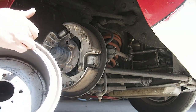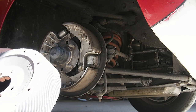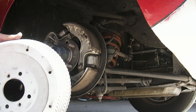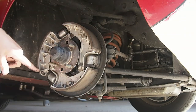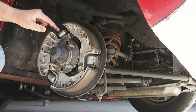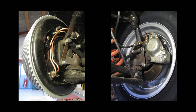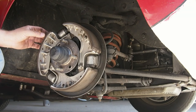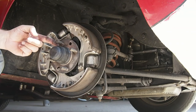There's a steel insert here, and Alfa Romeo took out a patent to make this drum in one aluminum foundry, where they could make these ribs and take the part out of the form. The internals are quite exciting — as you can see, it has three shoes and three separate pistons. The drum brake and the disc brake actually fit on the same spindle, but this is Alfa Romeo's own setup for drum brakes. It was perfected by the time this drum brake setup came out. They were a bit reluctant to go to disc brakes, just like many other Italian car makers.